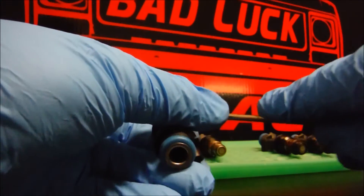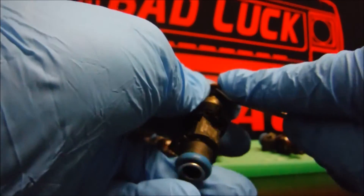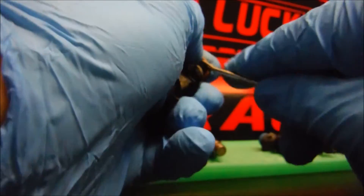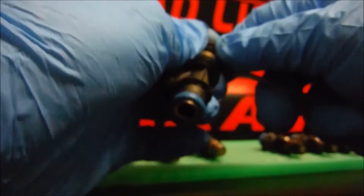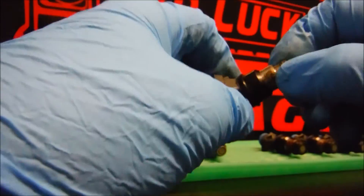The fact of the matter is I'm doing this because number one I need to have these injectors tested — they're making a lot of noise. And since I have to have them tested anyway, it's the same price to test stock injectors as decapped ones. I need bigger injectors anyway; I'm running at 116 percent duty cycle at 6,000 RPMs. I've been short-shifting my engine because these injectors aren't keeping up, and I don't want to go lean or risk one getting hung open. This is my budget answer for the moment.